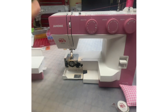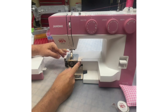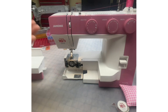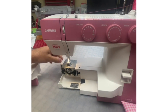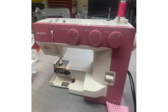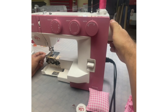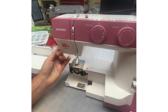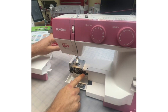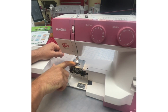When people re-engage the lever after free motion quilting and their feed dogs aren't coming back up on their own, don't panic. Just rotate the balance wheel — always make sure it's going counterclockwise, turning the wheel towards you. By turning the wheel towards you, your feed dogs will raise up. When you re-engage that lever, the feed dogs aren't going to come up all on their own. Just rotate the balance wheel and there — your feed dogs are up.